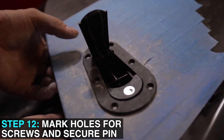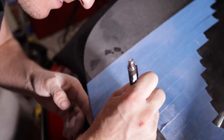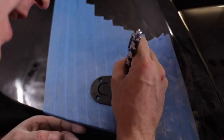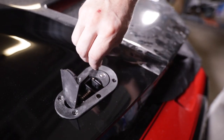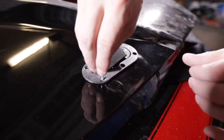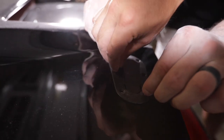Check it out — number two is in! Now what we've got to do is just line up the strike pin, put it through, get the same holes in, and we're good. It's like when you start the first one you're just like, 'oh man, we've got so much to do,' and then by the time you get to the end of the second one you're just like, 'oh sweet, I'm the man.' So we already have the bottom piece in, so now I'm going to use a screw, get down there, screw it in, get the other side, make sure I hit it, screw it in. Now both are screwed in and we can pull it up and tighten the top.